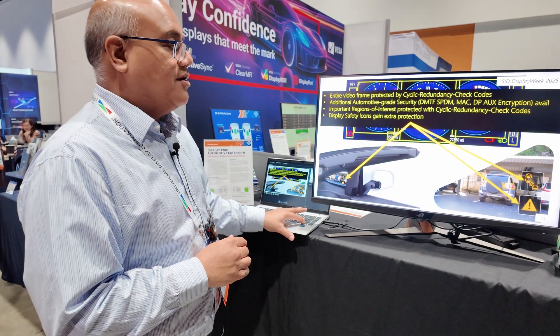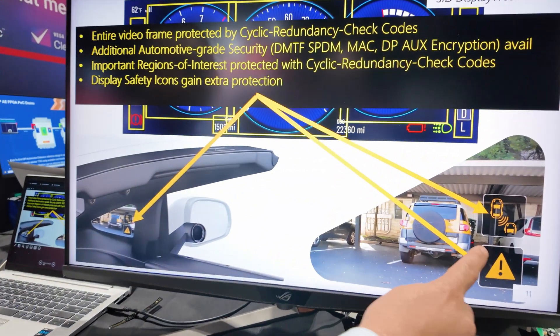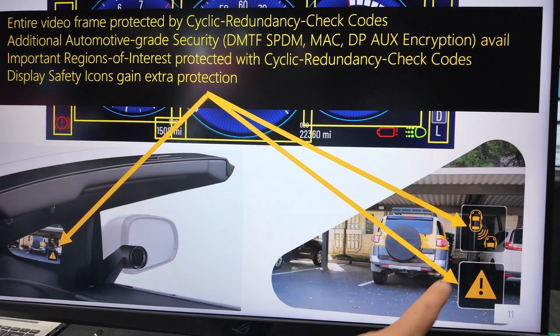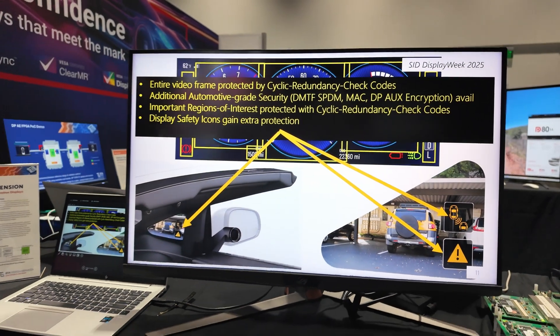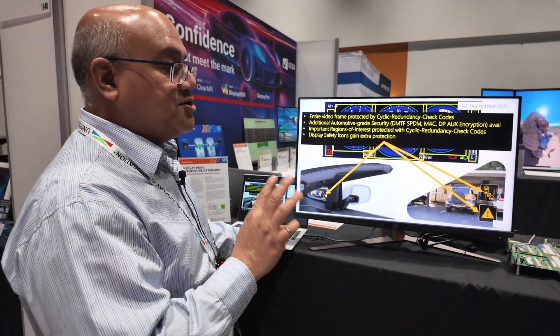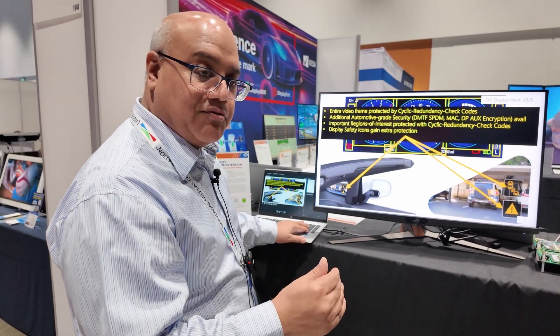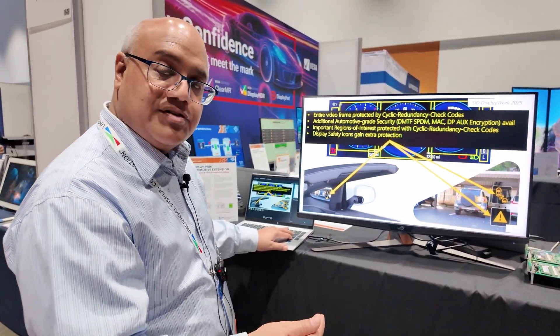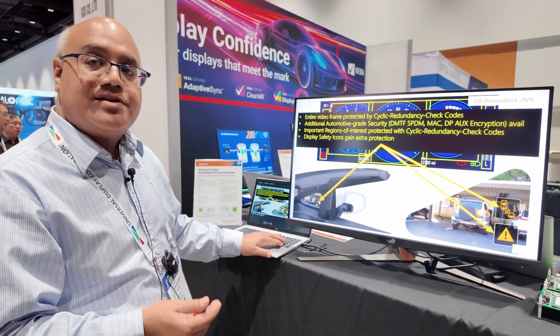You can see these different icons. If there is some sort of mistake or broken icon as you're changing lanes, our new protocol will indicate electronically that you have a problem. So there's encryption going on? There's both. There's what's called a CRC mathematical algorithm to check for functional safety. And with our advanced profiles, we also have security.